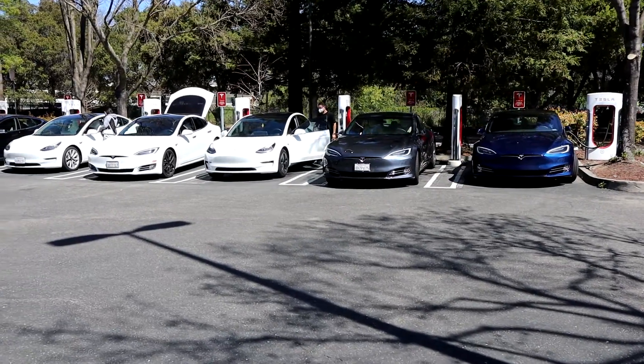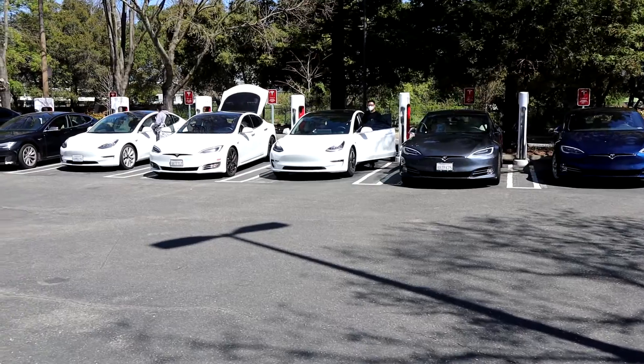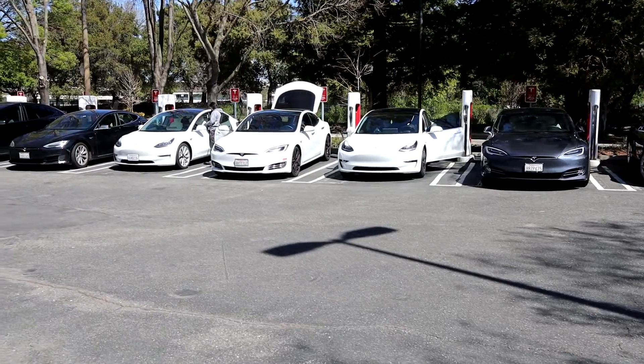One last thing is that lithium ion batteries are quite a bit lighter than lead acid batteries — about one third of the weight. It's about a nine pound battery compared to the standard 12 volt in the Tesla Model 3, which is about 27 to 28 pounds. In the EV world, we always talk about efficiency, so having a lighter battery is nice.